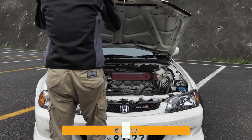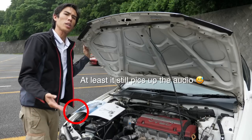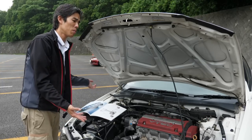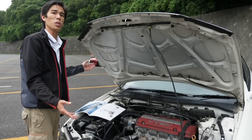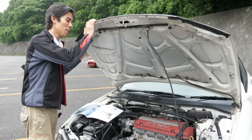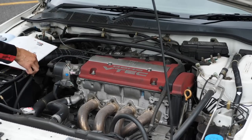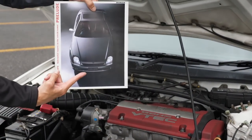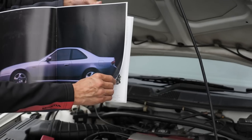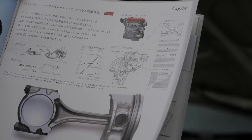What's under the bonnet? This is a huge engine. The bonnet is not aluminium — Honda typically doesn't use exotic expensive materials for their bonnets or fenders, except the NSX Type R which is carbon fibre. Many people do change to aftermarket carbon fibre bonnets to make it lighter. The H22 engine is actually derived from the last generation Prelude BB6, released in 1996 as the Type S with the wonderful ATT-S torque transfer mechanism. The H22 engine has the red top — as explained previously, the red top is the highest spec of the H22 within the Honda family.